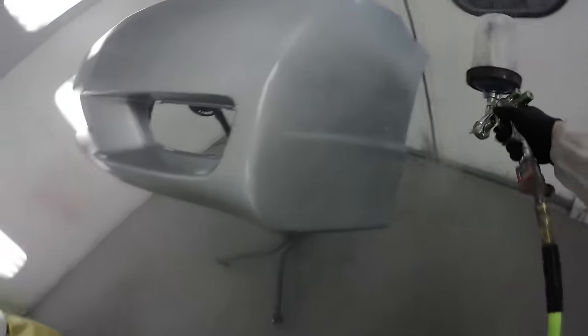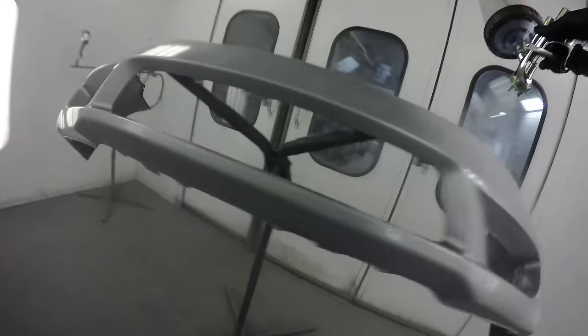You can see the cup on the top — that's the 3M PPS cup. There are a few different paint preparation systems. Most guys have moved away from the traditional cup on the gun. These systems have the filter built in and make cleanup a lot easier — you just throw the liners and you're done. This gun I'm running around 26 PSI.